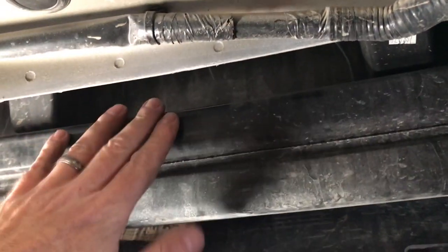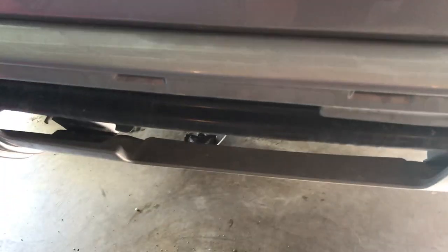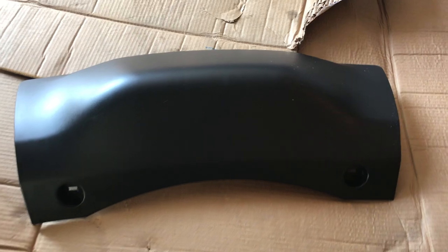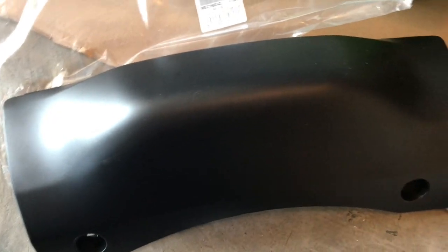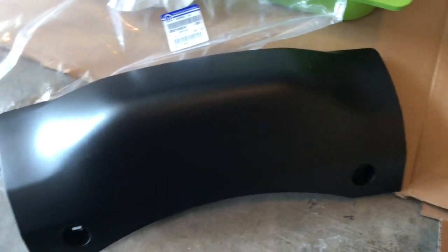Really all you're doing is replacing this bumper here — this is where your hitch receiver is going to go. We're going to remove the rear cover; there are a couple of little plastic screws that you just unbolt, and then the cover comes off. This is the replacement cover that you get, which has a bulge in it to accommodate the hitch, and it just goes on once the hitch is on. You can get this sprayed or leave it the same color. This is the part number for the hitch cover, but if you do the Mopar hitch kit, it's included as part of that package.